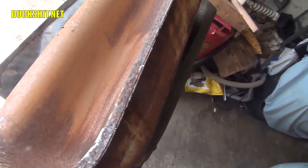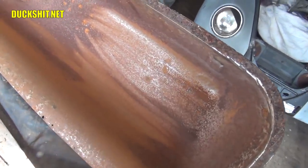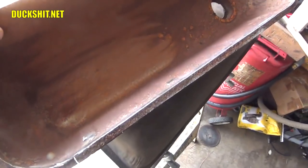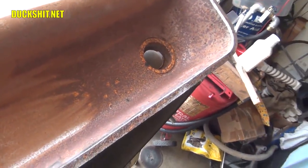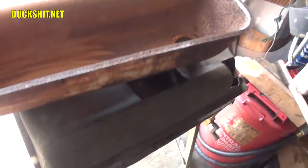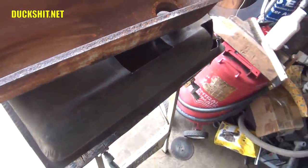I figured I should try to scratch out as much of the rust as possible, which mostly looks like it's superficial. I'm actually burning down to shiny metal, so the inside top of the tank is not in too bad a shape. I was a little concerned this was going to take a lot of work, but we're going to coat the inside of it anyway, because when you weld these things, you never know if you're leaving a pinhole, and the coating will fill pinholes.